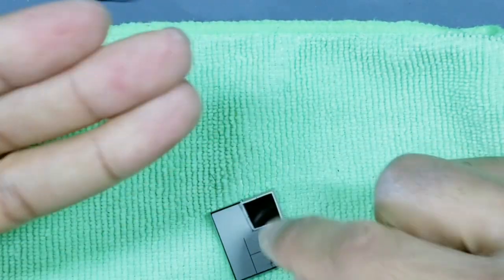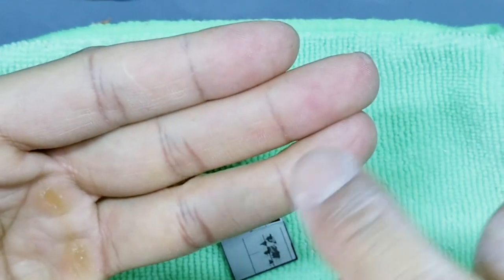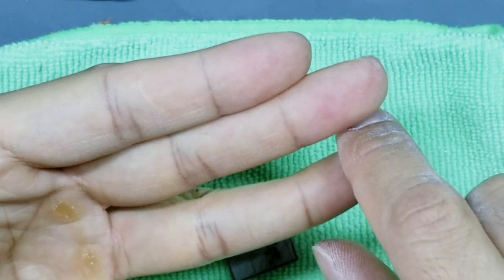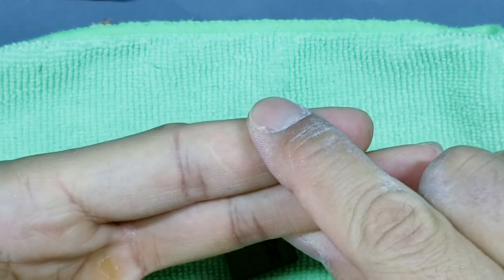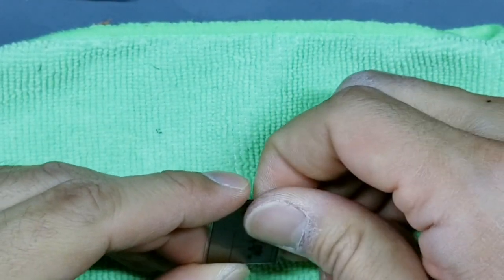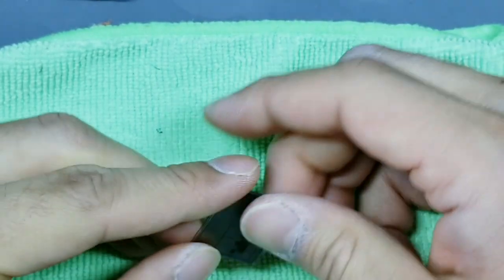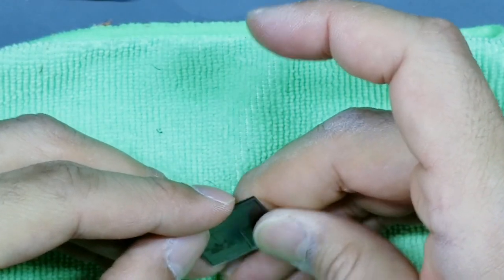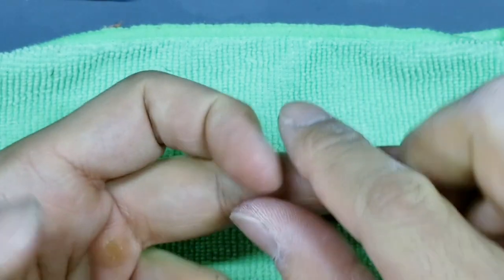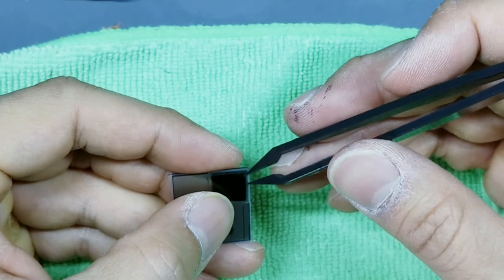Remember that the polarized film has the sticky middle portion, which is the film. It has the sticky part, the plastic backing on the sticky part, and another protective film. We've peeled away this part and laid this down, and now we're going to press on top of this to remove any air bubbles. Once you feel that you've got that in place, we can remove this last protective film off, and you're just left with the middle layer. So we'll take this portion off.